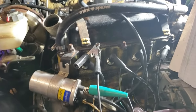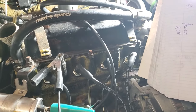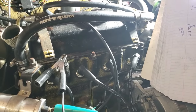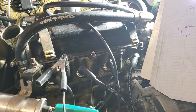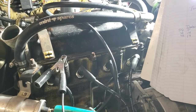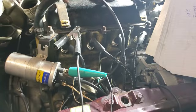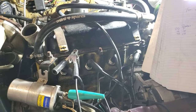After checking the timing, it's clear I need to change the distributor. At idle it's 10 degrees, then 14 degrees at 2,000 RPM, and 19 degrees at 4,000 RPM. To get 30 degrees all-in at 4,000 RPM, I'd need to add another 11 degrees, putting idle timing at 21 degrees and 2k at 25 degrees — so the curve on this is bad.